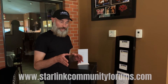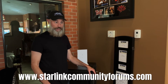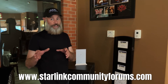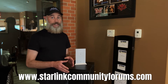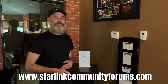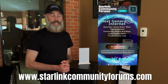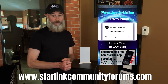After walking through the house and seeing where the red is on our Wi-Fi scanner — the range tester — we can take this router and try to move it to another area. Sometimes there's a challenge with that and it's not so easy, so then you might look at getting a booster. The other question is how bad is that internet signal when it is in the red? You're still getting internet in those dark red areas, so the real question is whether it's working strong enough for you. The Wi-Fi range testing tool is a great tool to use, especially when setting up, but it's not the do-all and end-all of everything. Don't get too worried about a little bit of red here and there — you might not be able to prevent it.